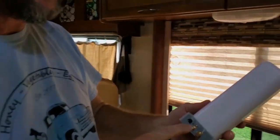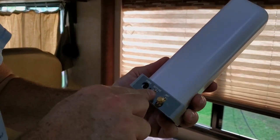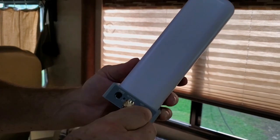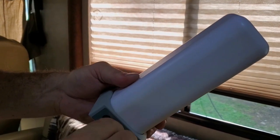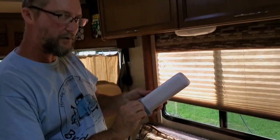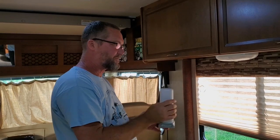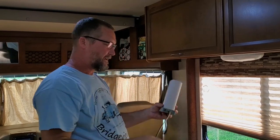On the back of the indoor antenna, there is a plug for the outside antenna connection, a power input, and if you're going to run a second interior antenna, you unscrew the cap and plug into that port. If you're not using it, you must have that cap on. Right now we're going to do a dry run before drilling holes and cutting into things — just to see what kind of signal differences we get, make sure there's enough distance below and above, and that we're lined up. If everything works out, we'll glue the mount onto the roof and run our wires.